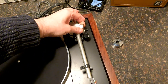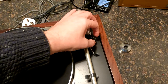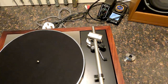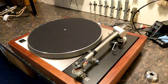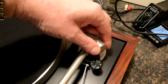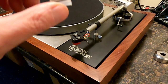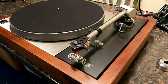We've got a few dials on here — a big dial on the side here which is your tracking force, and the little dial at the side there which is bias, or sometimes confusingly called anti-skate, which is a really misleading term. I'll try not to use the term anti-skate, because it suggests it stops the tonearm skating, which has nothing to do with it really. What you want to do is set everything to zero — the calibration on the top here needs to be set to zero, the little dial there needs to be set to zero or off. Also, just remove your stylus guard as well, because when you're calibrating you don't want to be weighing that — we're trying to set the weight at the cartridge end, so having it on will affect the figures.